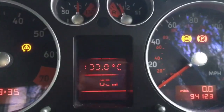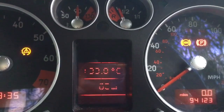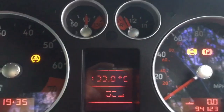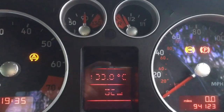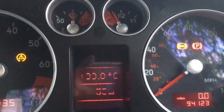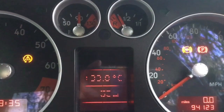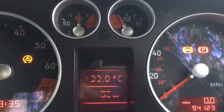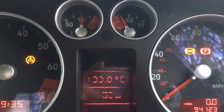I've had a fault creep up on my year 2000 Audi TT Mark 1 with the ABS — it's intermittent. The ABS light is on now, but at times it's just the ABS light on its own rather than the traction control light as well. I'm thinking it's a dodgy ABS sensor. I've plugged the diagnostic machine in but I can't find the fault using a normal OBD reader — it needs a VCDS Vagcom, which I don't have — so I'm going to try and do it the old-school way.